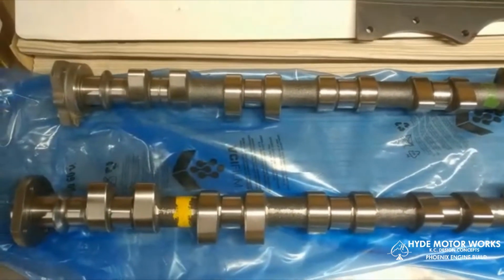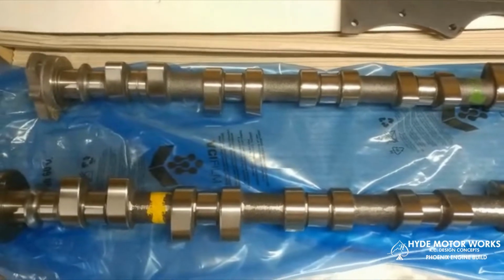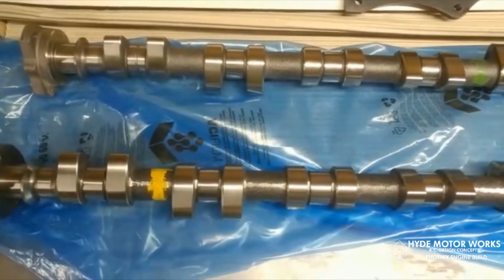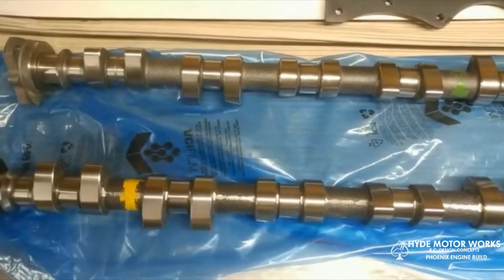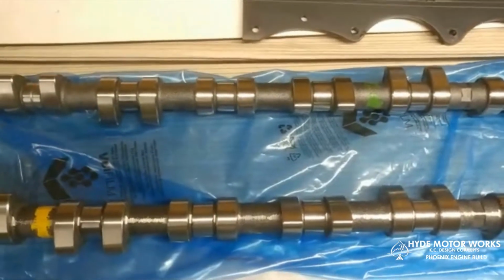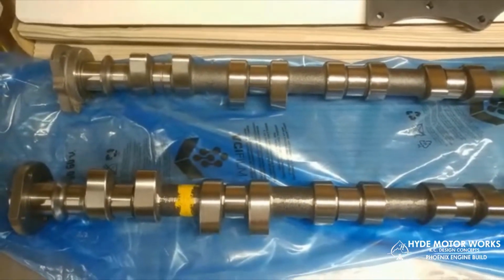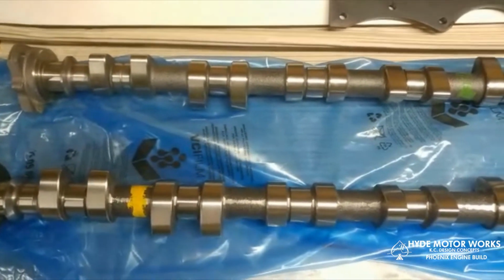And one of the things I noticed with the dyno runs that we did was that where the horsepower should have been really taking off, the boost increased. It increased from 14 to 15 pounds at 4,000 RPMs, and it shot up to a little over 18 at about 4,500, coming up on 5,000 RPMs, which with a positive displacement blower is odd. Typically the boost gets up to where it's set to and kind of maintains throughout the RPM range, but I saw the boost jump way up.